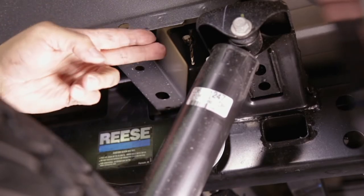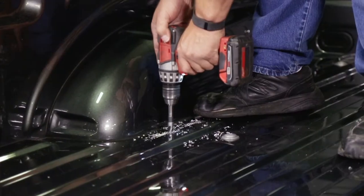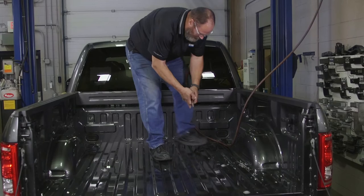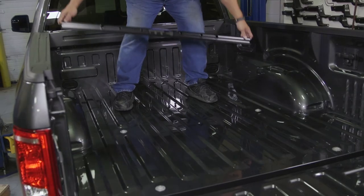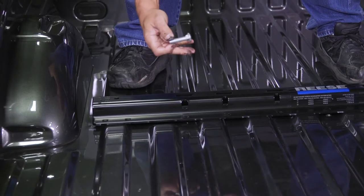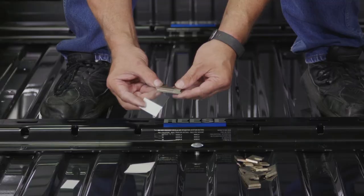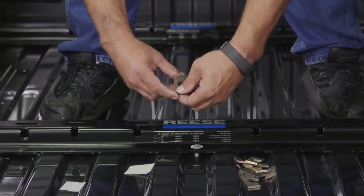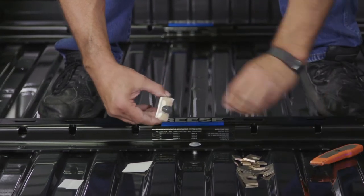Now check that the 1/8 inch drilled pilot holes align with the slots of the frame bracket. Once alignment is confirmed, enlarge the 1/8 inch drilled holes to 9/16 inch. If needed, file the edges of the newly drilled holes and apply a coat of touch-up paint to help prevent rust. Reposition the rear mounting rail over the newly enlarged holes, then install the 2-inch carriage bolts and place U-shaped spacers in the corrugation between the bed and the mounting rail — use two U-shaped spacers stacked on top of one another. These spacers can be held together when applying the provided galvanic isolator squares; use a knife to slit the isolator squares to allow for mounting bolt access.